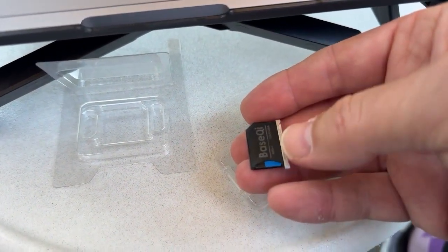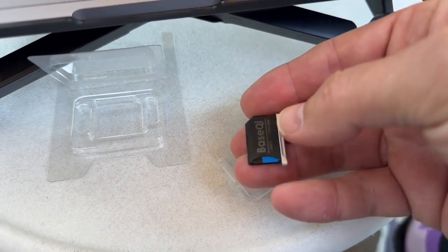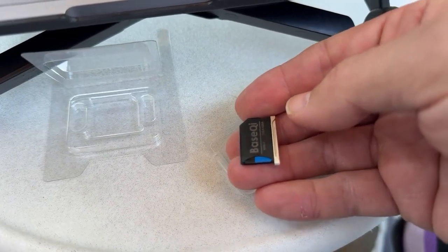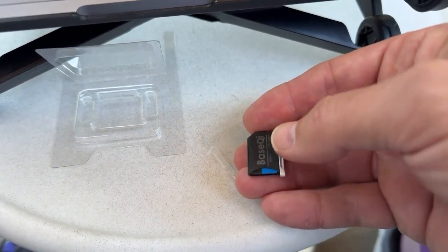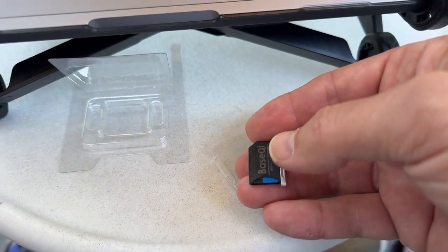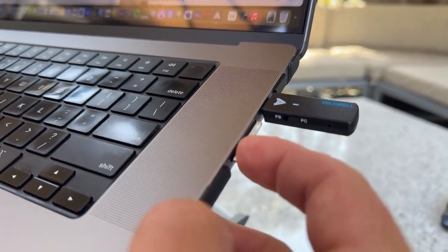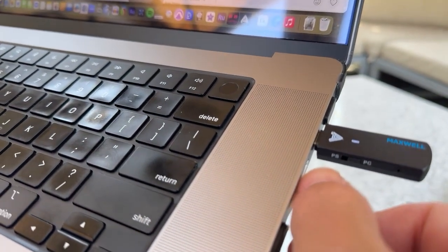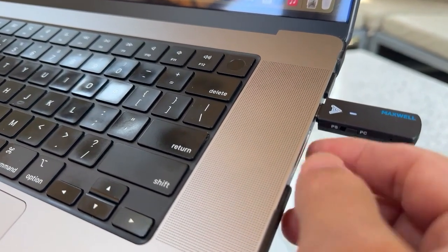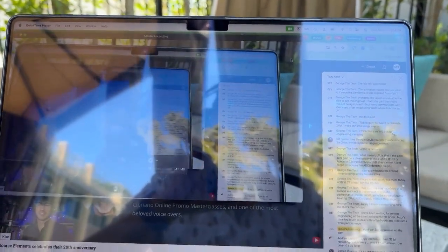There it is — the card is now inside the card reader. This card reader actually cost more than the card. The card reader was like $35 and the card was $30. So all together for about $65 you have half a terabyte of storage, doubling the capacity of my 512 gigabyte internal storage and providing a nice place to put files without carrying around another drive or a hub. Let's slip that in. I want to make sure it's all the way in. If you don't have a fingernail, you can always use a small screwdriver to pop it out. I'll go ahead and allow the accessory to connect. The next thing we'll need to do is format, so we'll go to disk utility.